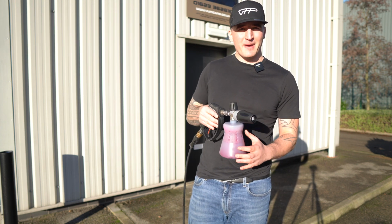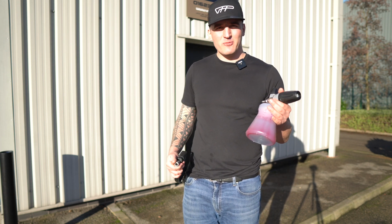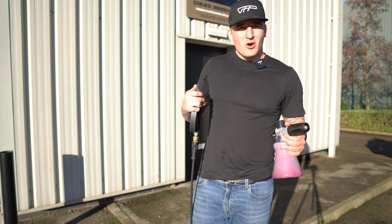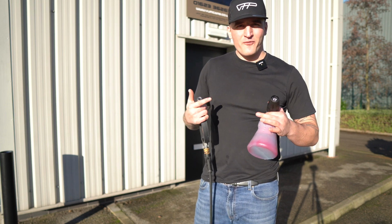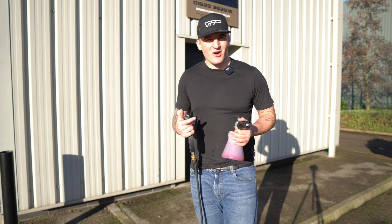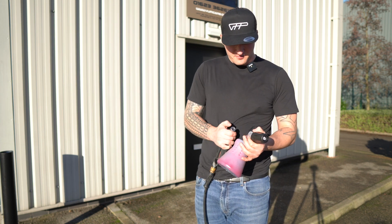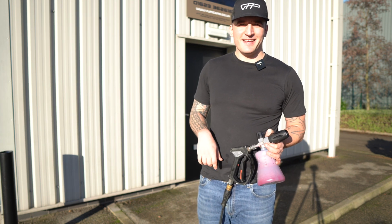Now, what I would always recommend, especially if you're using thicker soaps, is to take the foam cannon and either put your finger inside it before the head goes on, or in this case, just give it a good shake. This is so the foam cannon doesn't pull up all the heavy concentration of the soap, and that way you won't get 15 seconds of heavy foam and then 45 seconds of just water pretty much. So you give it a good shake, just make sure it's all mixed in. Now I'm going to show you exactly how it works.